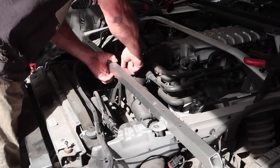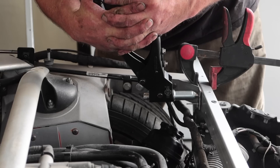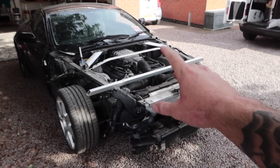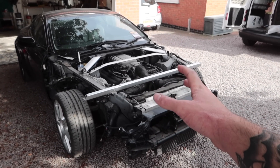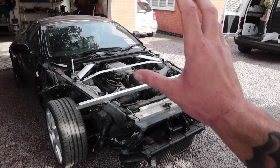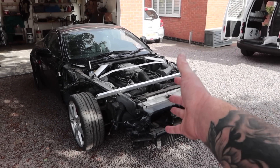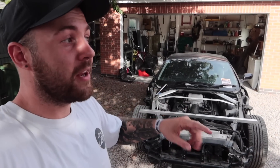With the panel bond on, we put those two bolts in to make sure it mounts in exactly the right place, then two rivets in each side to secure it perfectly. Just like that, it's done. The new headlight bar is on — better than factory, I think, because normally you get one rivet each side bonded, whereas now it has two each side and is bonded too.